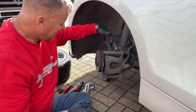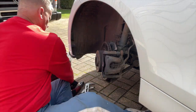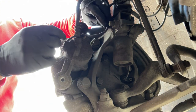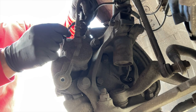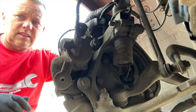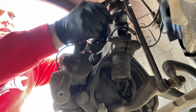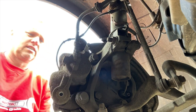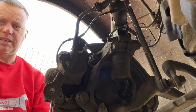This disc — I can feel it on the back — this one is a lot worse than the other side. Let's whip this one apart and have a look. It's got a little nipple there — we just pop the little nipple off and then the brake wear wire becomes loose, gives us a bit of wiggle room. We've just popped that one off out of the rubber there, so now we've got plenty of play on it. I can swing this one up like we did the other side — just get my screwdriver in the bottom and lever it up.